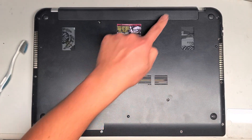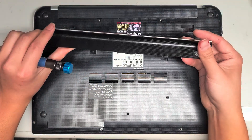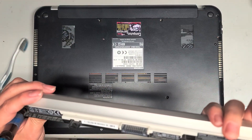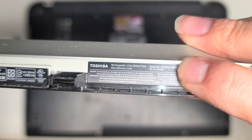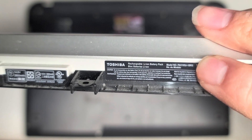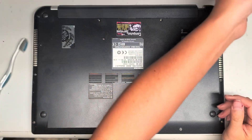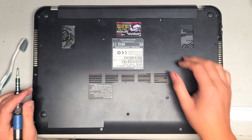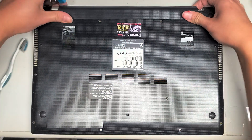To remove the battery, you just want to remove these two screws here. The model number for the old battery is on this sticker — it's really hard to see — but this is PA5195U-1BRS. You can also just look for a battery for the S55T model because they do have compatible models. Once you remove the two screws, you can just pull the battery out.